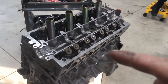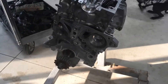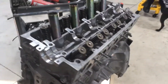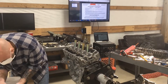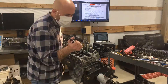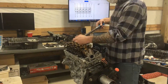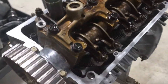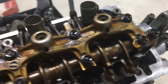Now I'm going to get the camshaft bolted in and the rocker shaft assembly, and we'll see how the timing marks line up. With the block and the head having both been milled, we'll see if we end up needing an adjustable cam gear or not. I got the rocker shaft bolted on. I put Honda Bond under the first cap and the last cap so I don't get any oil leaks.